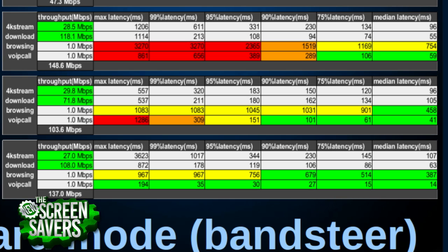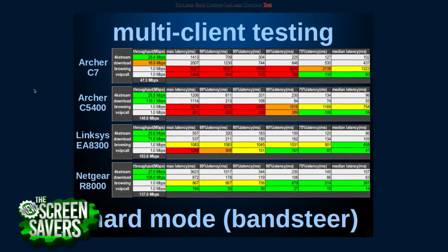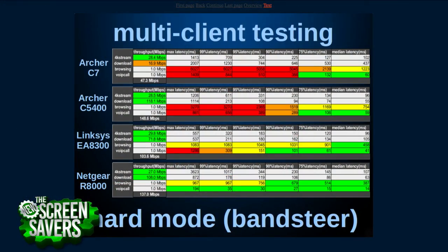But I mean, both radios are in the same tiny little plastic box. Right. So other than some weird artifact of, again, RF multipath, you're not going to see any difference. And in fact, I say that's hard mode, like I just let it do its own thing. But for the Linksys, sort of yes, sort of no. All 4 devices hopped onto the same 5 gigahertz radio, and I actually sat there and just disconnected and reconnected one like 5 times before I managed to get it to just randomly finally decide to switch to the other one. Wow.